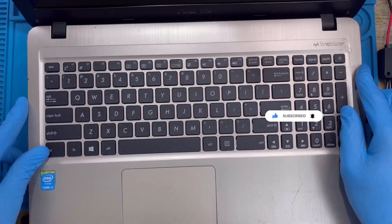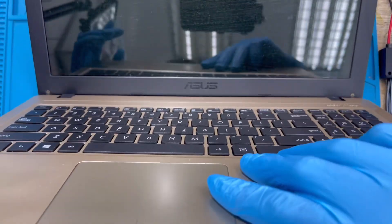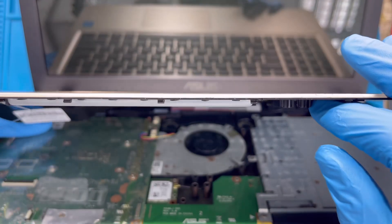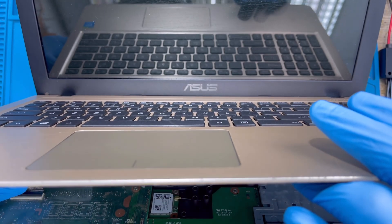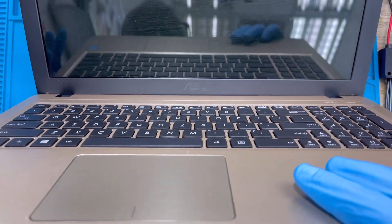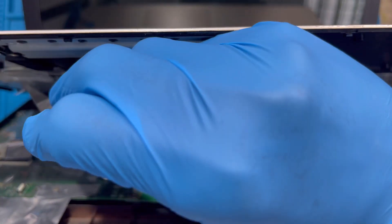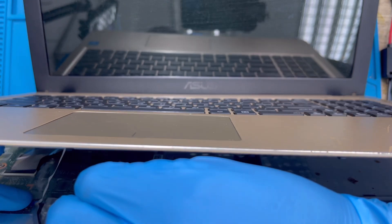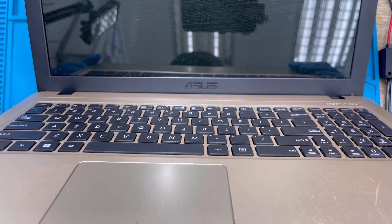Slide the cover straight, then fix the connectors. Fix the keyboard connector first — get the right position and put it in very straight, exactly how you took it out. Then close it. Also fix the mouse connector here — make sure you put the connector in very nice and straight, then close the connector.